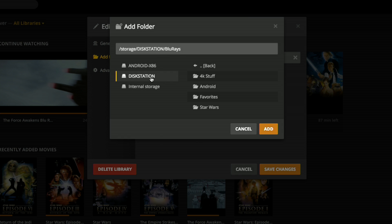If you have a 16-gigabyte Shield and want to do live transcoding, you need to have enough adopted local storage for this to work, so you will have to plug in a hard drive and do the storage adoption — watch my video for more information on that. The storage needs to be internal to the Shield in order for it to run its caching for the transcoding. This will work on a 16-gigabyte Shield, but you'll have to plug in that external drive and adopt it. If you have the Pro Edition, no need to do that — you've got 500 gigs of internal storage, and you can plug in more devices via USB or SD card to add more.